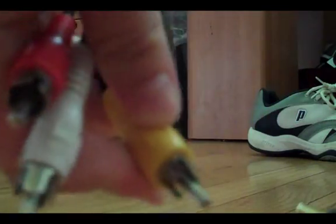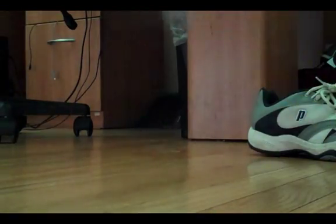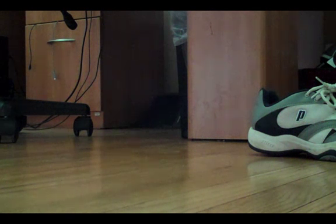Now for people with their computers far away from their PS3, take these little adapter connectors — I don't know what they're called, sorry. Take your RCA cables and put one connector on each end. I have two RCA cables that connect together and run all the way to the other end. Plug them together matching colors: yellow into yellow, red into red, white into white. Then mine runs on to the second cable which reaches the PS3.